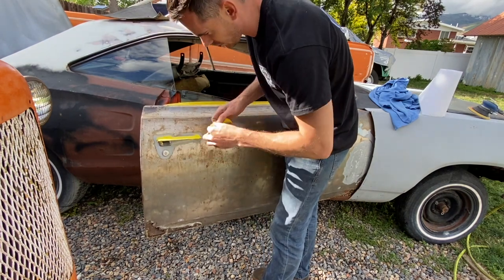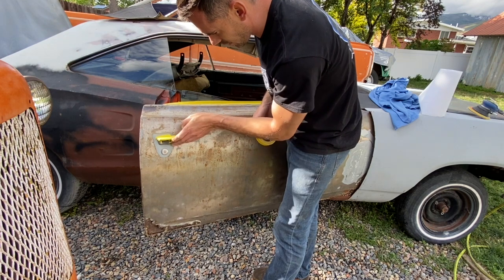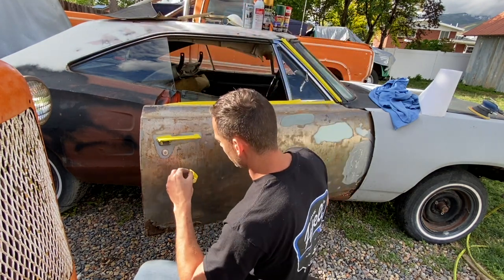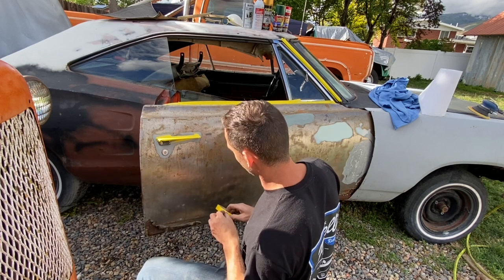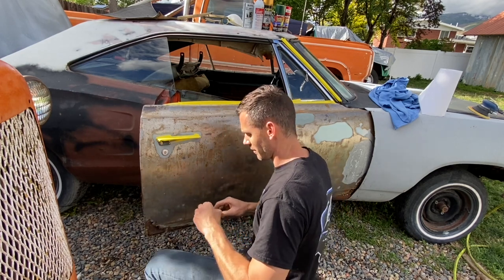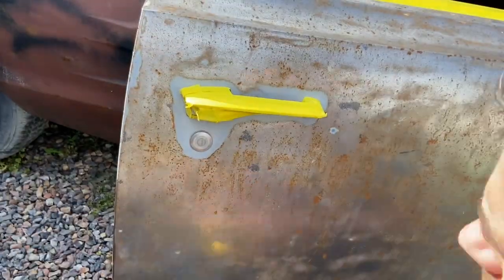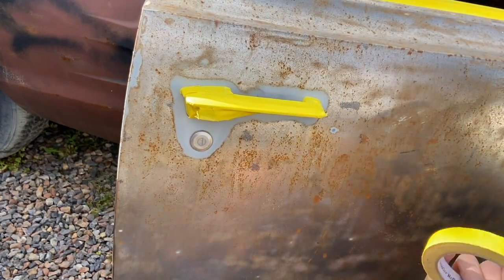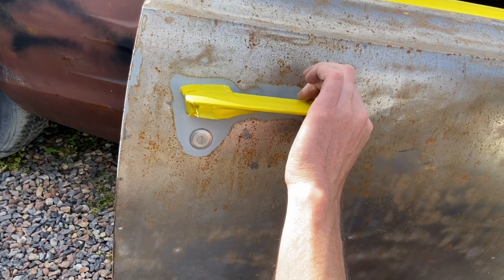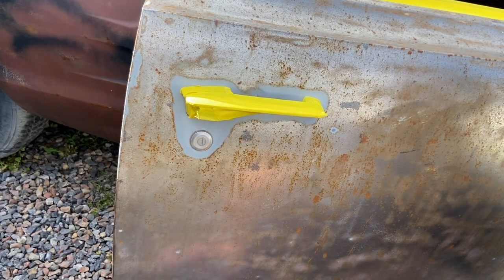The key to masking in a professional sense is your overlay — how much you're laying one layer over the other, making sure there are no gaps between them. You don't want that paint getting through. Here obviously we're not being super precise because we're just messing around in the backyard. When it comes to masking tape, 3M yellow automotive masking tape is my favorite. It rolls pretty well, and the green version is a little more flexible for pulling lines, but for general masking for priming and painting it's really great.